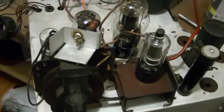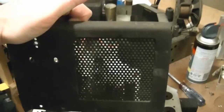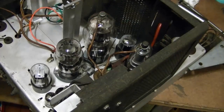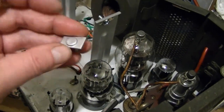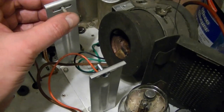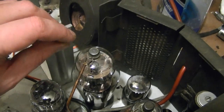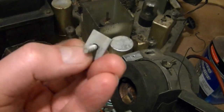I finished cleaning up the high voltage area, put in some good tubes, and now I'm going to reattach the high voltage cage, and then I'll thread through the high voltage wire and reattach the anode cap. While cleaning down inside the high voltage cage, I found one of the missing mounting brackets — this is for the focus coil support. On the other side, a wing nut's supposed to be there, so I picked some up at a local hardware store. The other side I'll just use a regular old screw — it would be nice to find one of these originals, but I just don't have anything like this lying around.